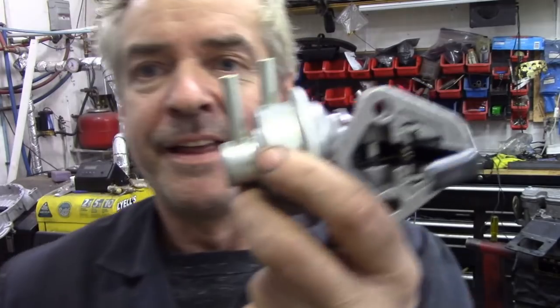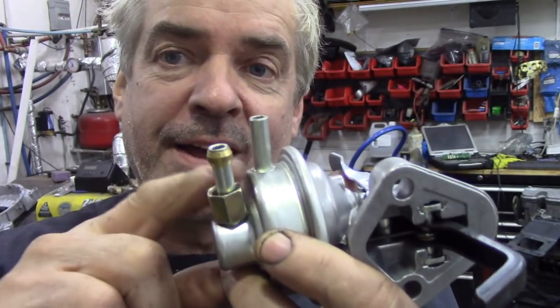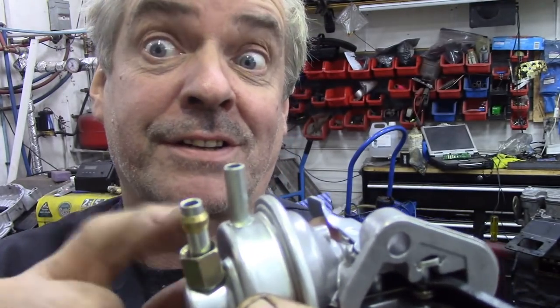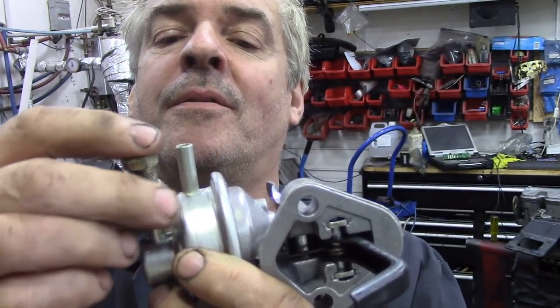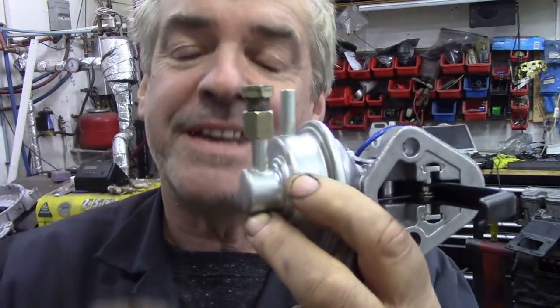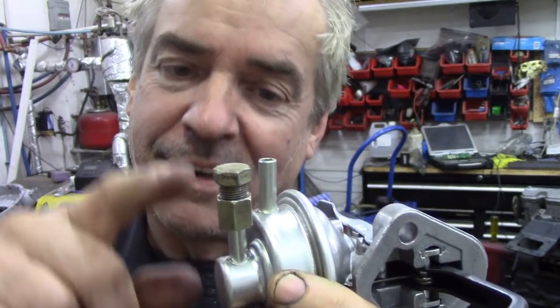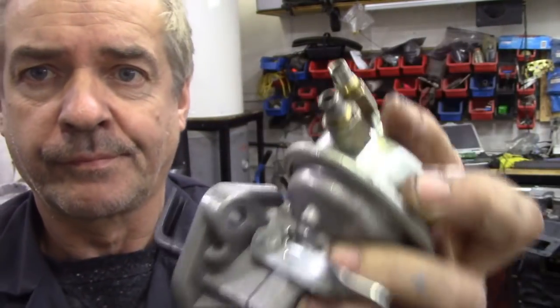When you put your union on there, you then put an olive on like this. Now be aware, these aren't like 5/16 olives, these are metric ones. But what you can do is this. Put that little cap on there, see it push the olive down, put this on here. So when I'm doing it sort of with one hand, but aren't I good? When you tighten that up, the olive will be in the right place for when you put the pipe fitting on. Isn't that clever? So instead of messing about by the side of the engine, you can pre-fit them before you put it on, and then it's done. How simple is that? There you go. Look at that. So they're already fitted, it won't drop off, and easier to fit than when it's on the engine. Do it in your hand, do it in the vise, easy.